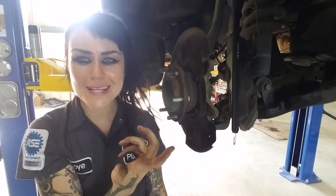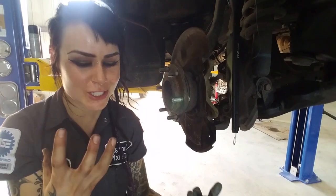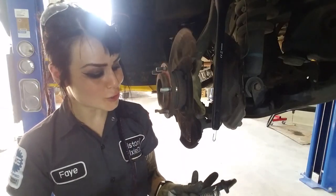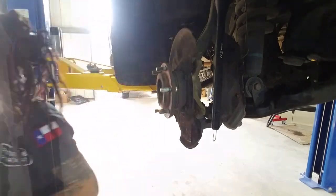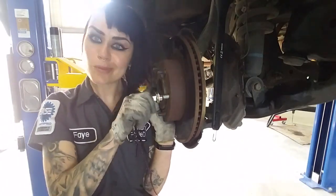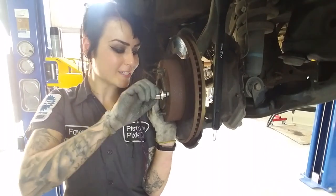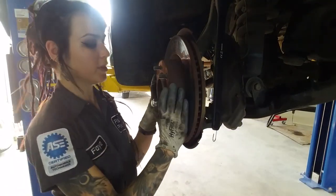My stud is nicely installed. But my phone overheated, so you didn't get to see the whole thing - now it only exists in my mind. So now I get to put this back together. Heck yeah. So I'm just gonna start by putting the rotor on. In order to get the rotor to sit in place, now that I broke it loose from its rusty life on the hub, I'm just gonna stick a couple lug nuts on there.